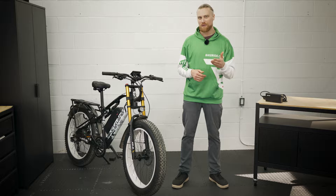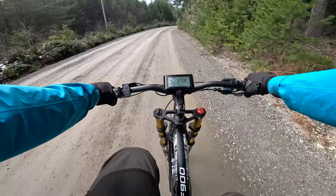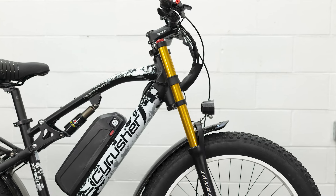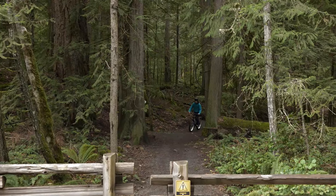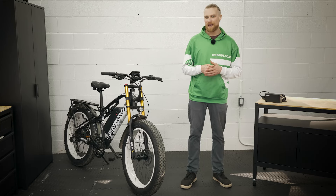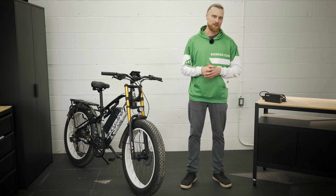You could only reliably read the battery level when the motor was not powering the bike. Our third con is the ride quality. It was a little bit less enjoyable than I'd previously hoped looking at the bike. The bike's front fork has a very steep vertical angle and it would benefit from a more slack head tube. As a result of this, the bike really pulls the rider over the front wheel, which is kind of uncomfortable on turns and descents, and it limits the bike's ability in different terrain. The drivetrain on the bike is also a little bit limited, which really leaves you ghost pedaling at high speeds. So overall the bike kind of felt inexpensive and ill-fitting. While I enjoyed certain aspects such as the large motor, lots of the small details made me feel like the bike lacked value in some areas compared to its price.